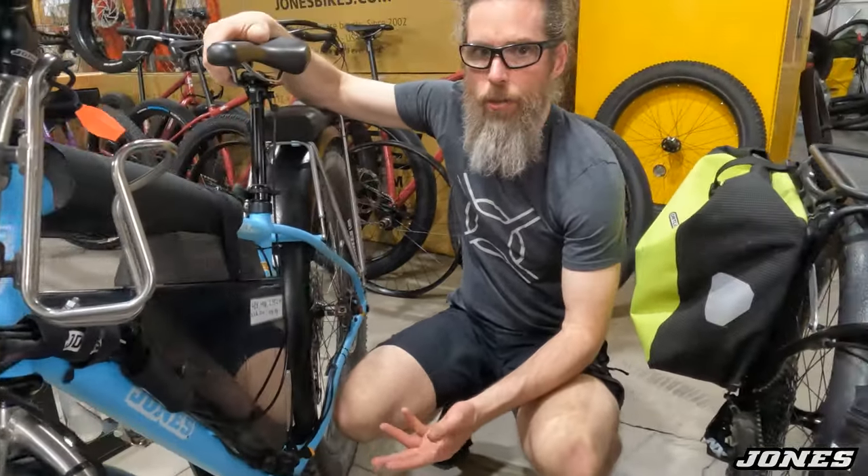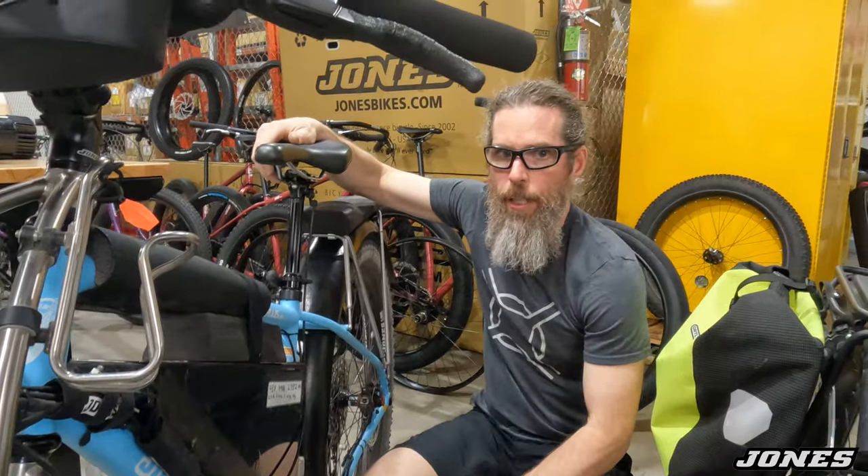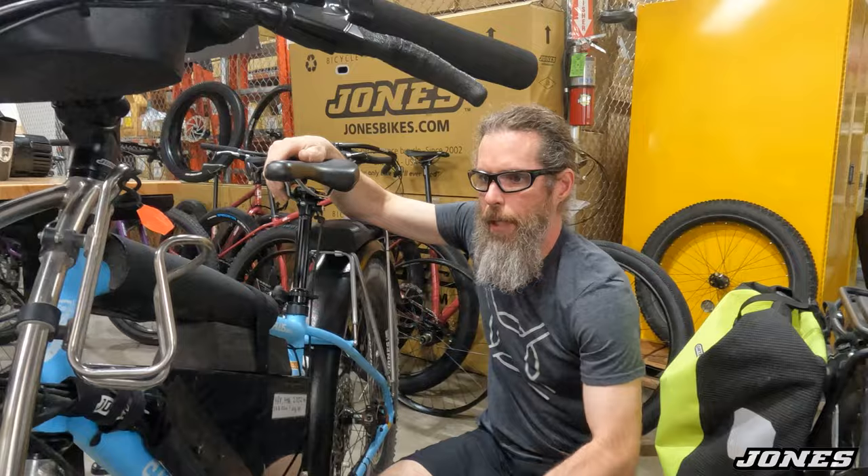Now I have some of the 48 volts being converted to 12-volt power, so I can run any automotive or motorcycle equipment I'd want — headlight, turn signals, horn, brake light, really bright taillights. I have always-on really bright taillights — everybody can see me from really far back and it doesn't use much of my battery pack.